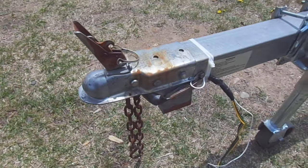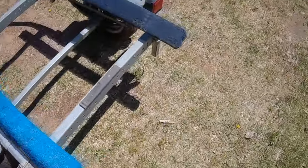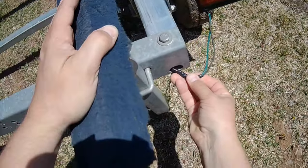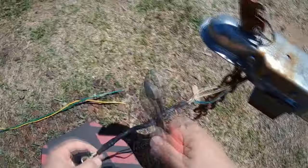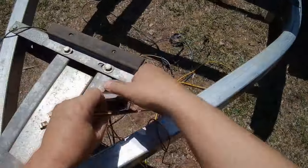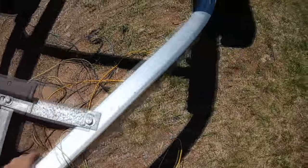Let's check out another boat trailer that I rewired and refixtured. Now, one thing that's different about this trailer is that the original wiring is run inside of the trailer frame itself. So that's how we're going to run the new wiring too. So instead of just going through and tearing out all the old wiring, we want to bring in the new wiring as we're removing the old wiring, right? We want to use the old wiring as a pull string for the new wiring, just like we did in that other boat trailer for that short length on that upright bracket.